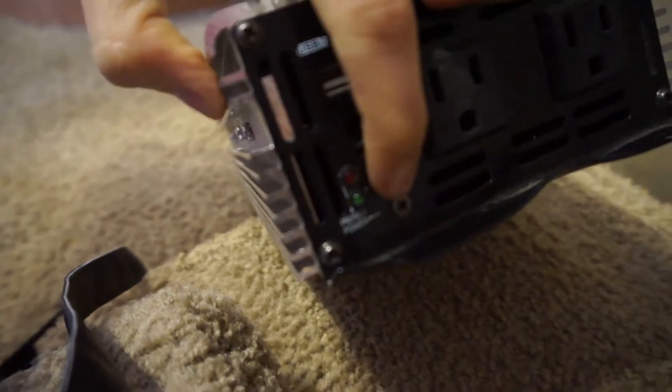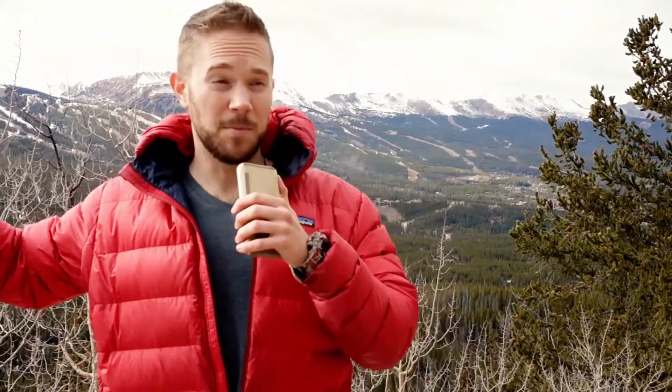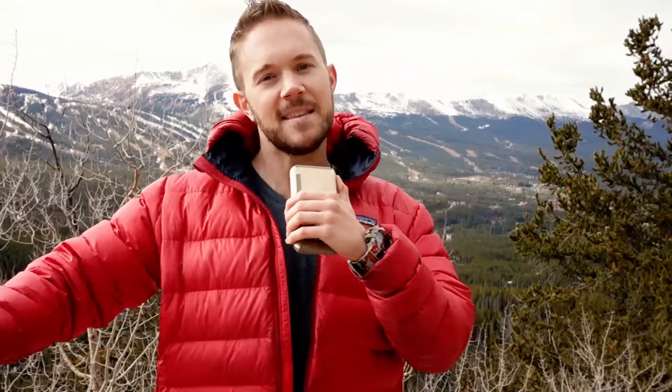Now, the one disadvantage of using these devices is that they're not that efficient. Some are better than others, but some can draw up to an amp of power just by itself without anything plugged into it while it's on. That's not a problem if you only want to turn it on for a short period of time — say, to run your blender, which is the only thing I really use it for, or to charge your laptop for a little while. But if you're going to leave it on for an extended period of time, especially to run something like a refrigerator that needs to run constantly, it's really not a good solution in terms of efficiency. You're going to lose quite a bit of power just from the box itself. I do recommend you get one anyway, because it's the one way you can power anything you would normally power at home in your camper or van.